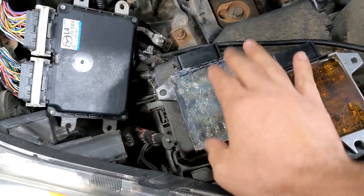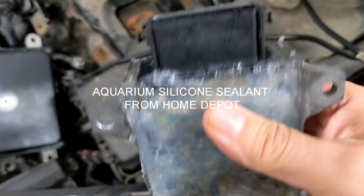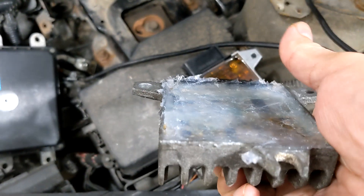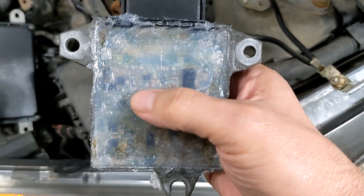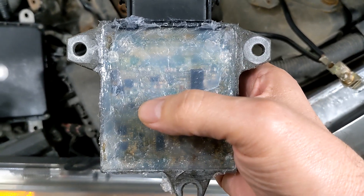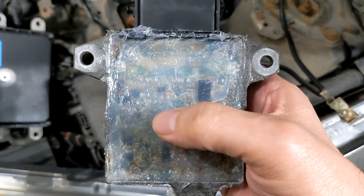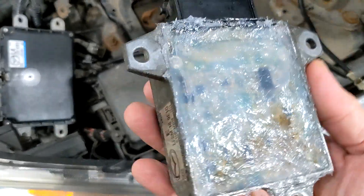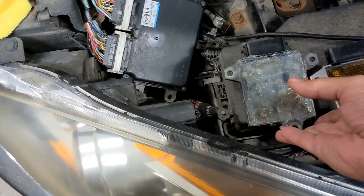So I'm going to re-pot it. There it is — it's been potted with silicone. Just made sure all the gaps are sealed, even around the connector. I'm going to probably use some neoprene wrap — it's not a tape, it's a wrap. It bonds to itself when it's stretched and attached to itself. Got to make sure no water gets in here. I already tested this a couple of times and there's no check engine light, no AT light, or traction control light on.